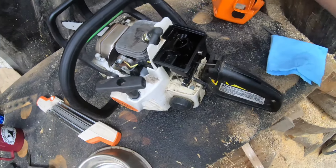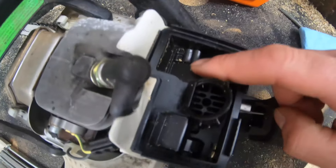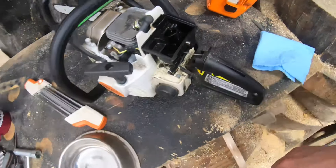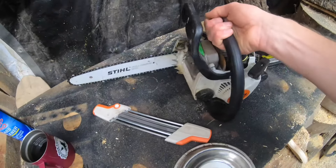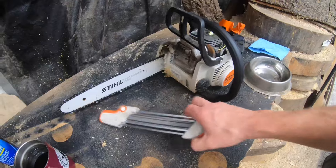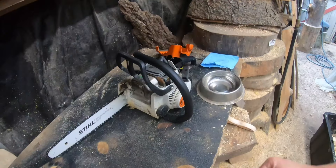There's a bunch of crud in here and I can see down inside there's some crud, so I think that carburetor's got some junk in it — no big deal, we'll do a clean on that. If you don't want to jump into a carburetor clean though, first look at your filter: is it clean or not?